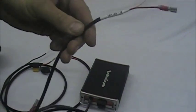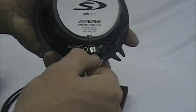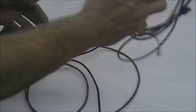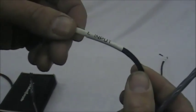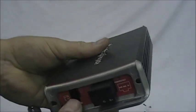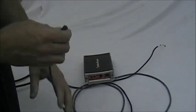When installing in the bike, you take the right speaker connector and plug it on. The connectors are different sizes so you can't really screw it up. The input side is the same way — it says 'amp input' on the label so you can't mix it up. Left input, right input — you take that on your amp, flip it around to the input side, and plug it right in. That's all there is to hooking up our system.